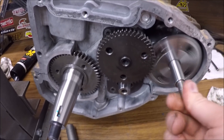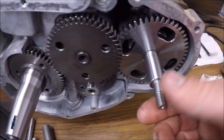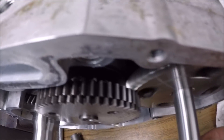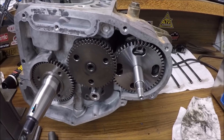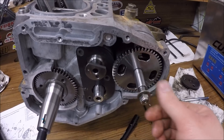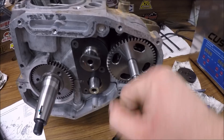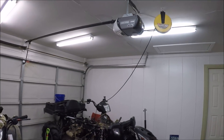Just make sure the gear is pressed on all the way until it does stop — it felt like it stopped the first time, but it hadn't. You need about a quarter inch gap there, but don't go by that measurement, go by when it won't go any further. We're all good now, we can start installing that back in. Torque down the oil pump in sequence: one, two, three, four. Put it on nice and tight. You can actually hear it pumping if you listen close. We've got a huge storm coming through right now but no big deal.